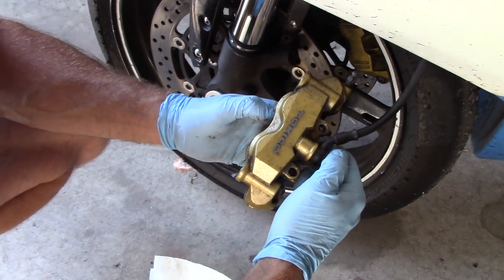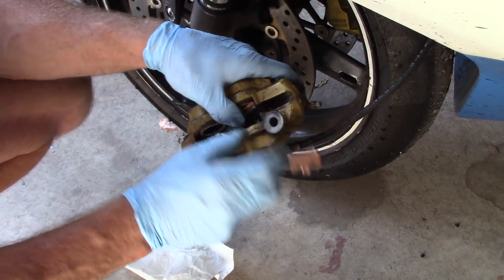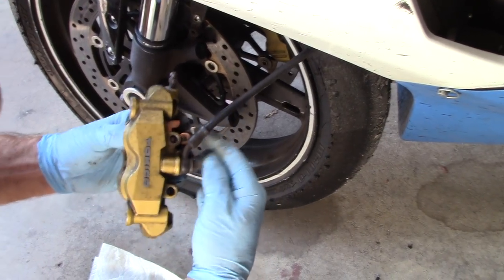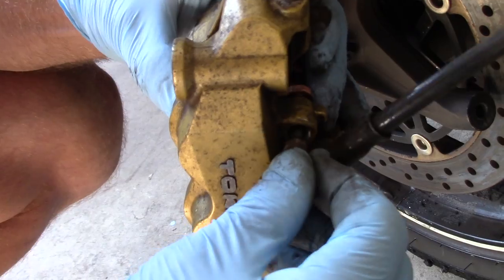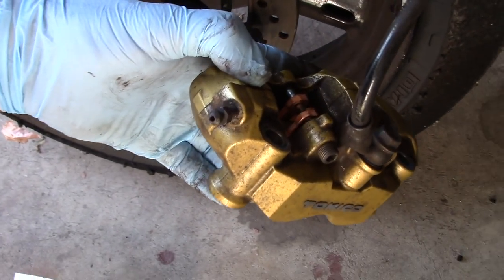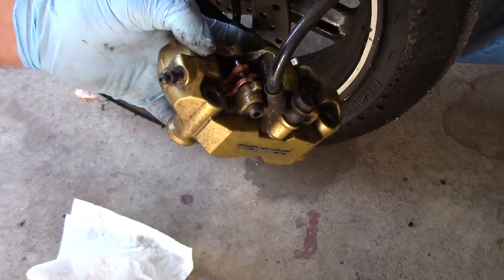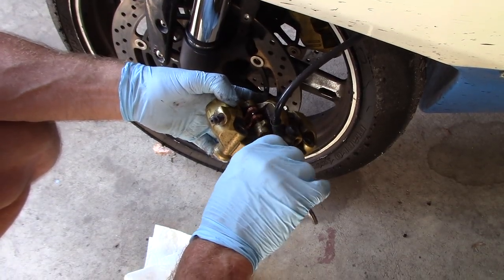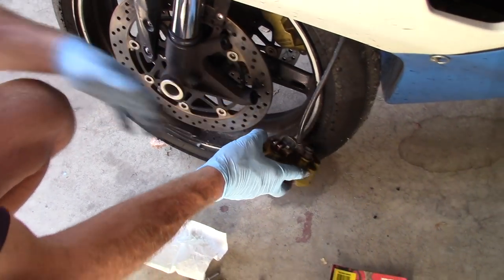Often there's no spring clip, so it's very difficult to get the pads actually lined up properly. We've got to hold one pad while we slide the other one through. We'll put the brake pin through — one and two. That's all safely located. You can use graphite grease, anti-seize grease, or whatever you want for the pin so it doesn't corrode and stick. But as this pin is coming out within the next ten days to two weeks, I'm just going to snug it there so it sits as far as it'll go. Then we'll go retrieve our other pad and put the back ones in.